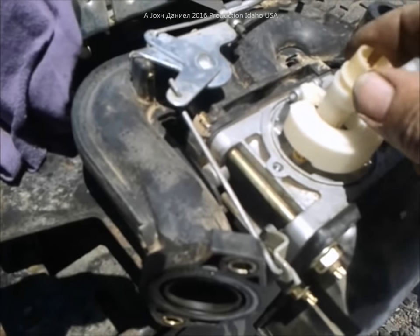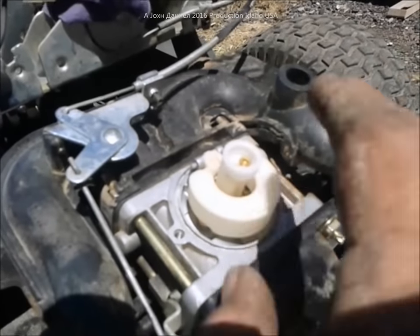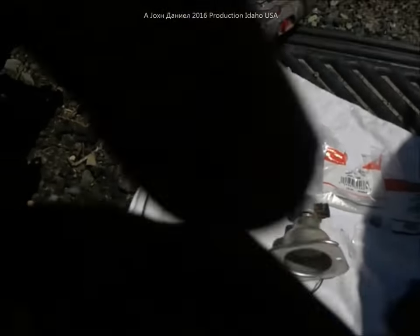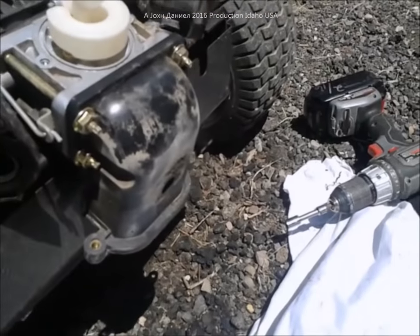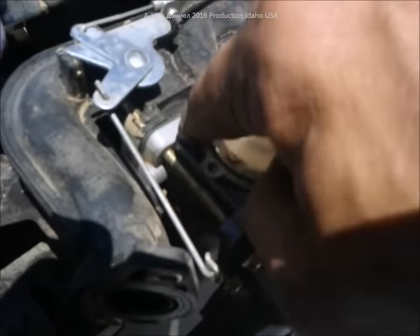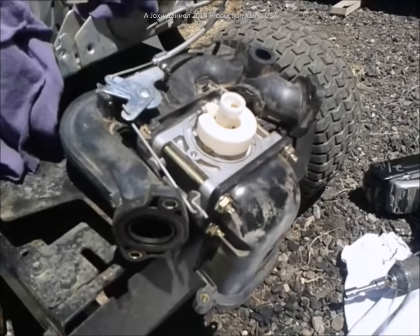We're going to take this O-ring and install it next — get the O-ring for it, fit into place. That's pretty self-explanatory. Yours will probably still be stuck in your fuel bowl. Get your new O-ring on it, put it together, and clean your surfaces very well. Do not use carburetor cleaner — I would suggest using a Q-tip and wiping it out with a little WD-40 or something. I wouldn't use carburetor cleaner because it will affect your new O-rings.